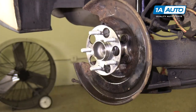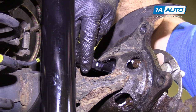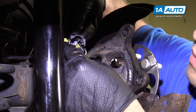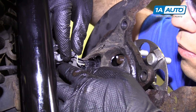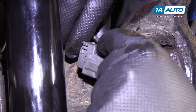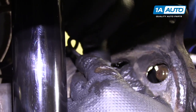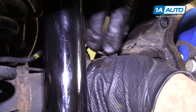I'll plug the connector back in. It's keyed — it will only go on one way, but the lock does go towards the bottom. It will click when it locks in place. I'm going to reinstall this gray cover. The wire did clip in here at the rubber part. Then push the gray cover over the connector so it sits like that, push this over, get that wire back in there. That clipped together just like that.